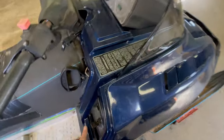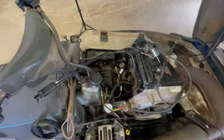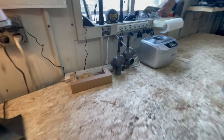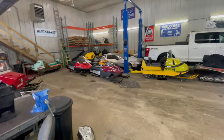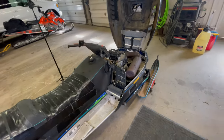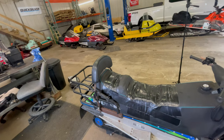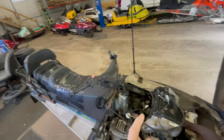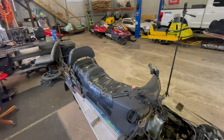So let's open up this hood, and I'm gonna show you guys. We're missing the carbs and the fuel pump. The reason why, I got the carbs right here, right next to my cookies. My buddy's sled, we nicknamed Clots, needed jets, and the ones that were on it were way too big. I knew this sled ran good before it bogged down. So we took the jets out of this one, threw them in there, so we could have it up and riding for a weekend event.